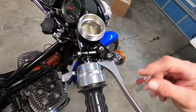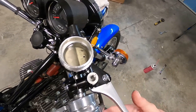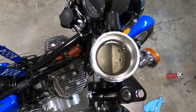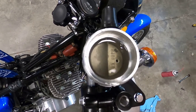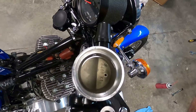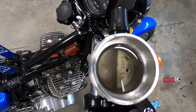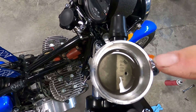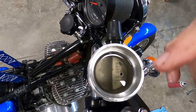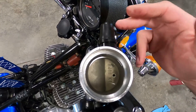If your master cylinder does not pump up from the gravity bleed, sometimes it'll actually grab. Sometimes the master cylinder will still be empty with the lid still off. What you want to do is pull the brake — you can see I'm getting bubbles. I've got hardly any brake handle at all; it's all the way back. Don't do it rapidly, do it slowly and let go slowly. You can actually see the piston going back and forth. The hole in the back is the intake, and the hole in the front is where the air comes back through — it's sucking in fluid and pushing it down the line.